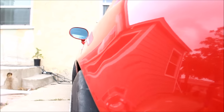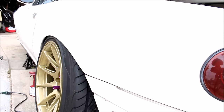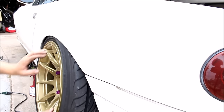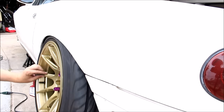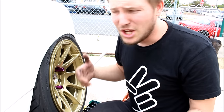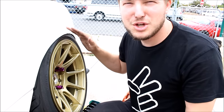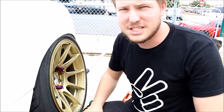You can see how flared out that fender is and you can definitely gain some extra clearance by doing that, but with the setup on this white car it's not really going to be necessary. This is what you want to end up with: I have the suspension jacked up so it's fully bottomed out and look at that — no rubbing. That means no matter what size dip or bump you hit, the tire is not going to rub on the fender. I hear so many people say they want to put stiffer springs or raise their car because the tire is rubbing, but this is the right way to do it — make sure the fender clears not just at your static ride height but all the way through the suspension travel.